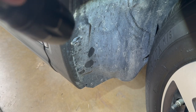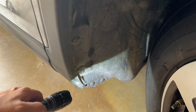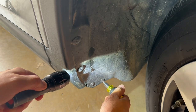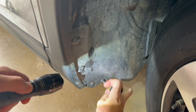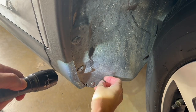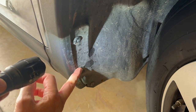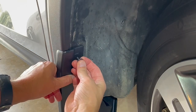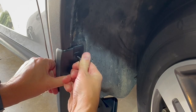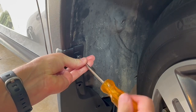So here we are on the front passenger side and there's only one screw that you need to take out. You'll see two self-tapping screws — it's going to be this one here. So you can take that one out. Then the next thing you've got to do is push out the center of these two push pins. You're just going to need a regular Phillips head screwdriver for this.